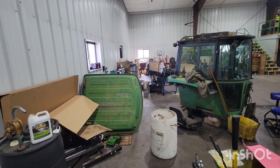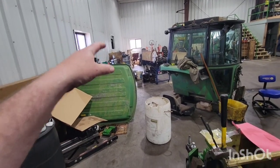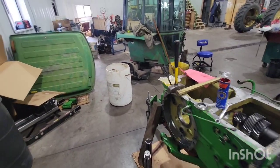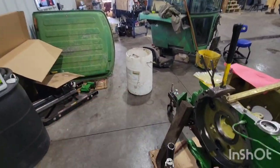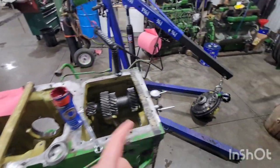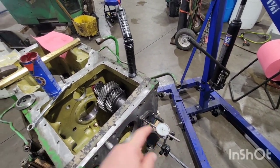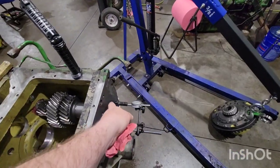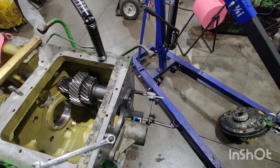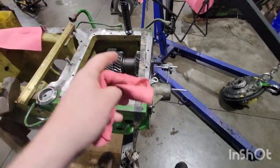Getting them in 350 degree oil works flawlessly — put them in, let them sit, and it works really well. So we got 29 thousandths. I had a 17 and a 10 for shims in there, so I took out 27 — that gives me 1 to 2 thousandths end play. Perfect, that's where we need to be.